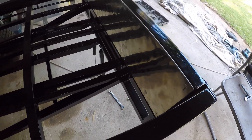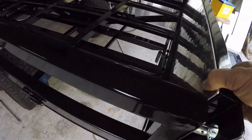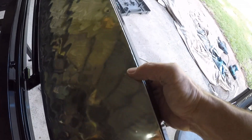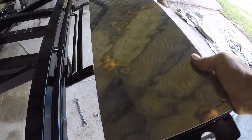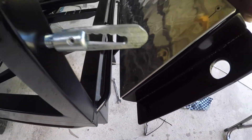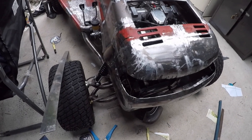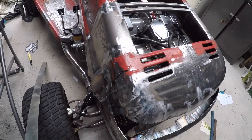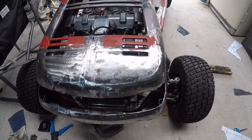I've started to put the aluminium on, so there's still a bit more work. One thing I did find — I've got the checker plate on the outside because I want it to be easy to clean. I found these really cool stainless steel rivets that are countersunk, so once they go in they're flush with the metal, which is awesome. If you use a shovel or something it won't catch on the rivet. I hadn't seen those before but they work brilliantly. I just need a few more rivets and I'll finish that off.